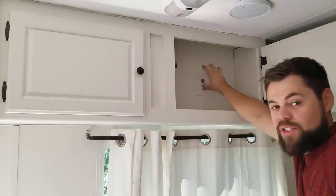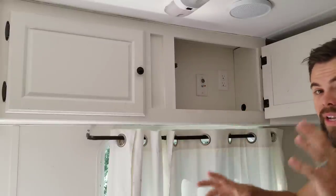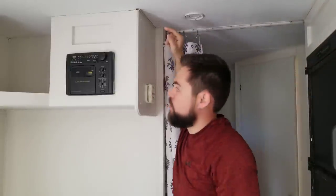If I really wanted to, I could take the wires off that plug and wire the fridge directly to those wires, since the DC wire from Amazon will reach all the way over. Another option is to run wires through the roof using a cable raceway — basically a white plastic trim box — and run the wires all the way around and in. I've already opened up behind the fridge to see how much room there is, and it's very easy to do: pull the old fridge out and the other fridge goes right in. There is also a smaller size fridge if you have a smaller camper.